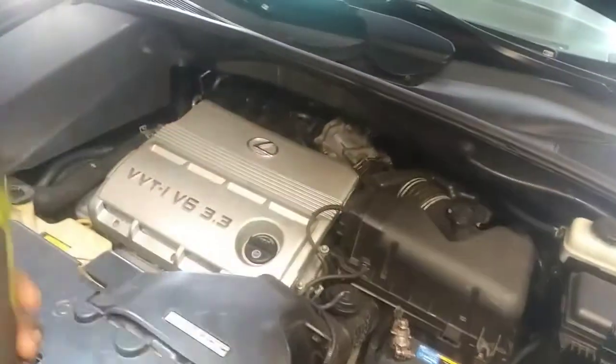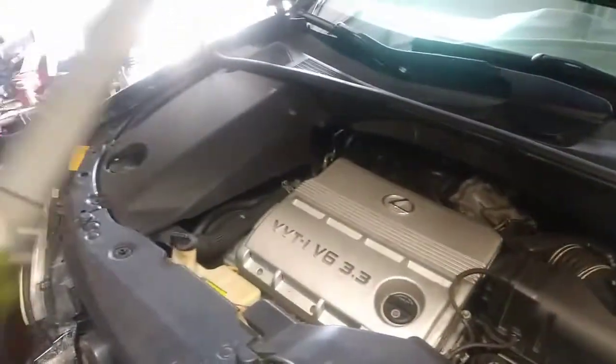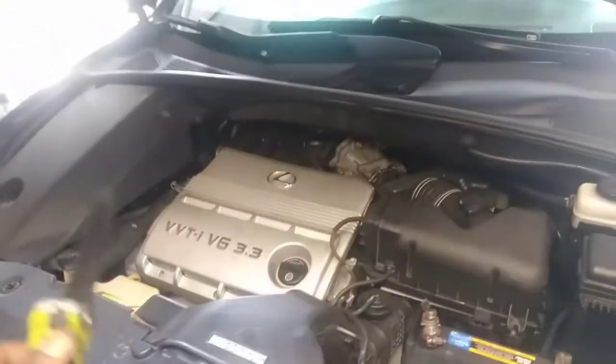So I'm thinking there's a pressure switch issue with the fan. Lo and behold, there's our problem. Somebody straight wired the fan here in efforts to not diagnose and repair the issue. So likely this is going to be my next video of repairing and diagnosing this fan control module. But you know what? I have a video already on this.